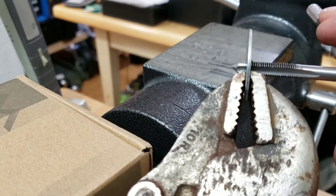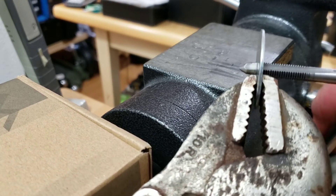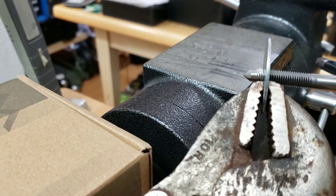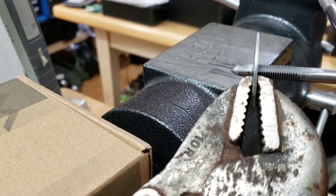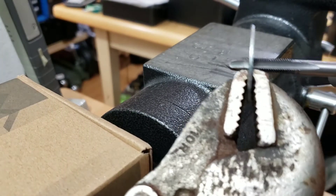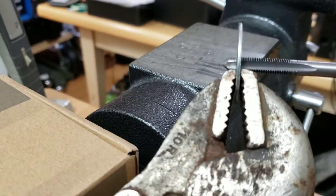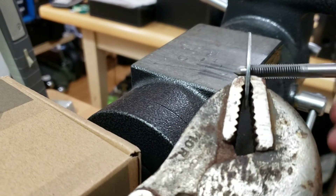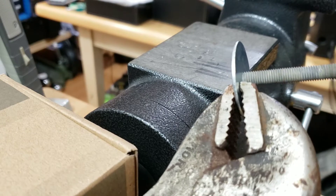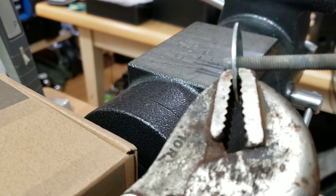It's pretty easy — I'm holding the washer with my trusty vise grip. The hole was only a little bit smaller than quarter-28 so it's going in no problem. If you have one with a bigger hole you can't use it, but if the hole is smaller you can drill it out a little bit to make it easier. That should do it — and our screw goes in great, goes in awesome.